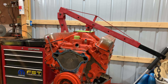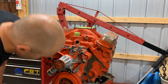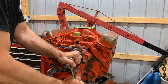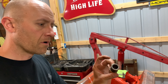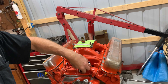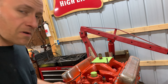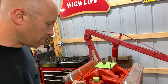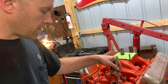I'm back at home and going to put the water pump back on. The final thing to do is take the thermostat bypass fitting off and screw in that big three-quarter inch pipe plug. I forgot to bring the correct large allen socket home from work, so I'm doing it the improvised way by sticking a nut inside there and turning it with a box end wrench.